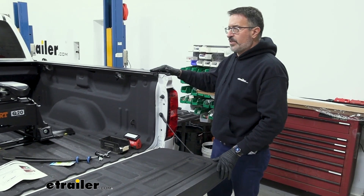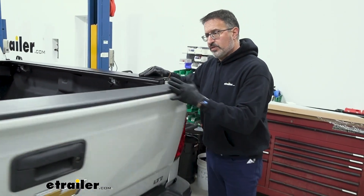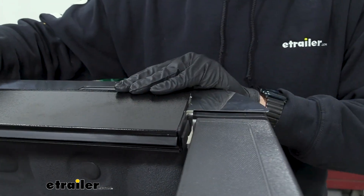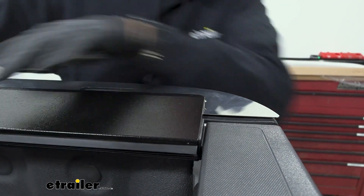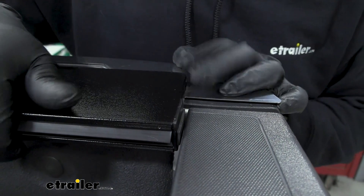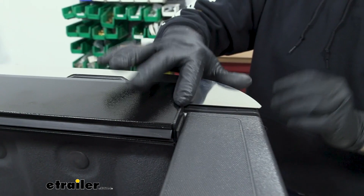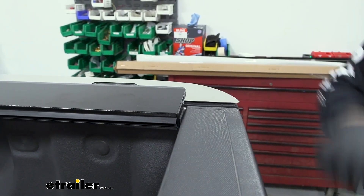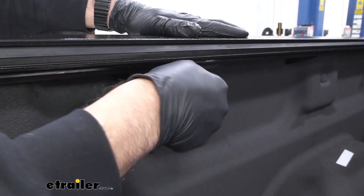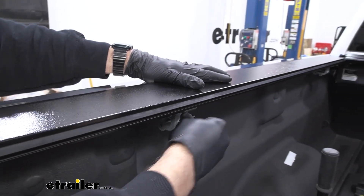To square the rails up, have the tailgate closed and check the gap at the tailgate. What you're looking for is a sixteenth of an inch gap. Grab the rails — this is why we kept the clamps loose. Set that gap on both sides so when you slam your tailgate, nothing bangs into the rails. Once it's square with the tailgate, go ahead and tighten the clamps down — don't over tighten, just snug. Do this on the rear, up to the front, and around to the other side.